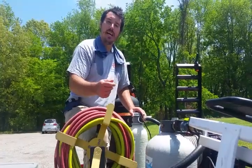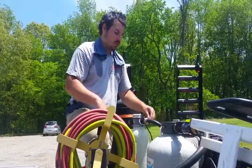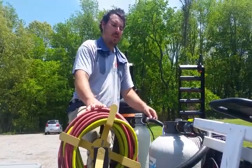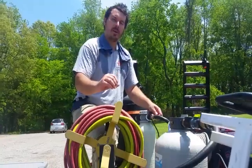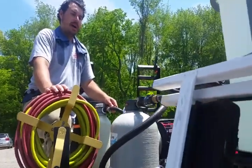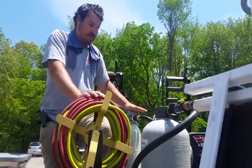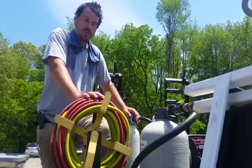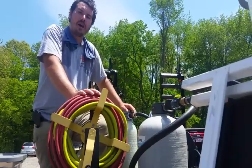And like I said, you get a TDS meter, run the water through it, and it should read 0. You can let it get up to around 5, maybe even 10 before you change it. You probably won't notice water spots, but like I said, it's supposed to be 0. It's supposed to do its job. So, I don't know if some people just think it's a myth or what, but these things really do work. Granted, you use them right and you keep the resin changed. Like I said, they will run out. They're not going to work forever.